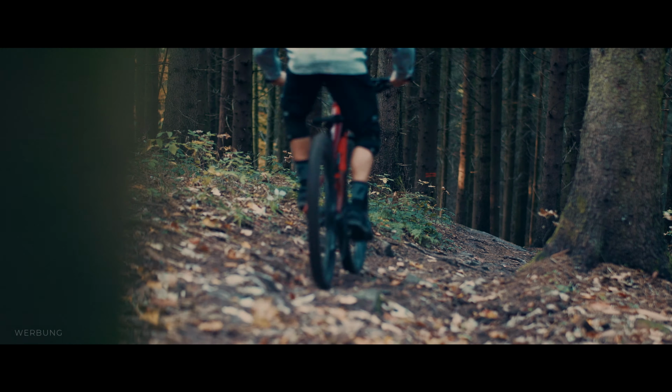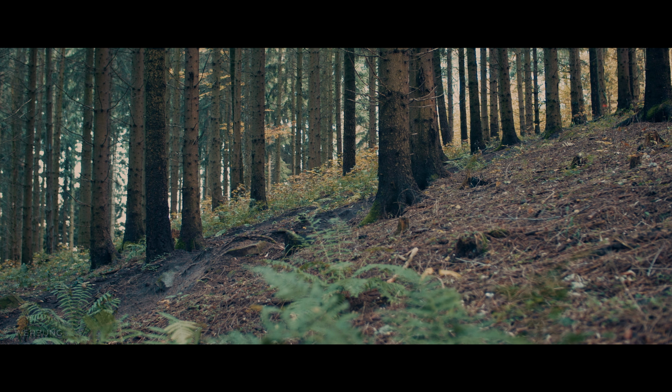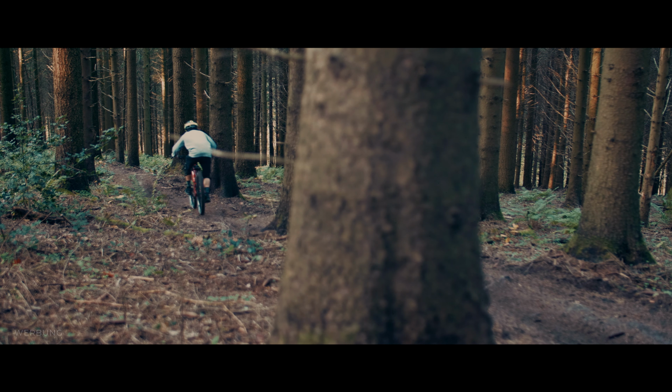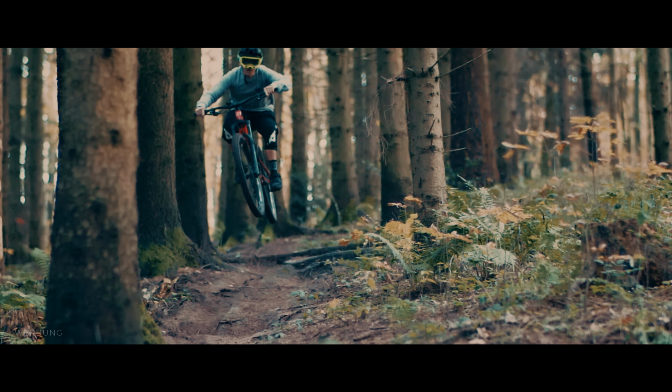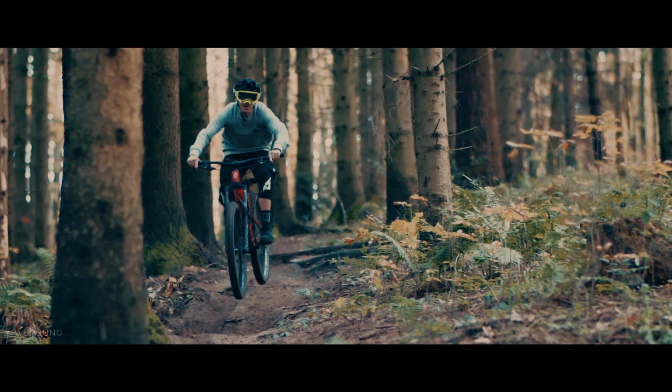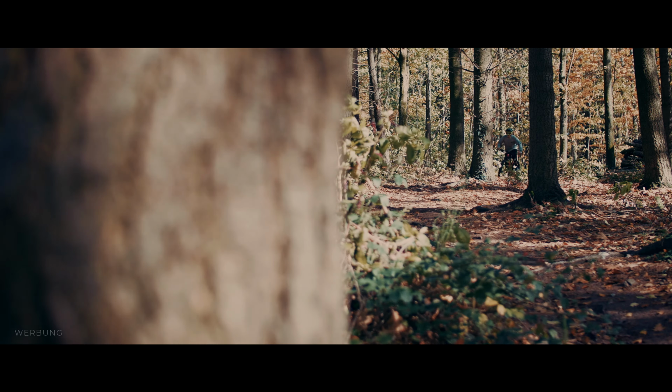This also means that the Swoop feels tight and always provides a good platform to pull out of tight turns quickly. The preset rear shock compression fits the kinematics very well. At any time you get precise feedback from the trail. I think here you could even get more out of the bike with a coil shock, but that is already whining on a high level.